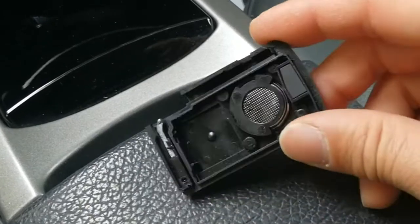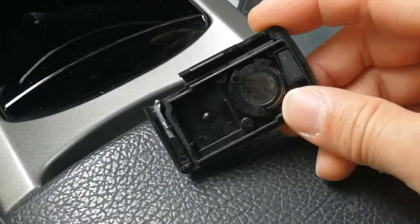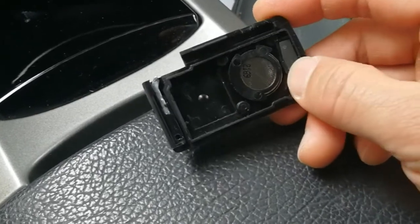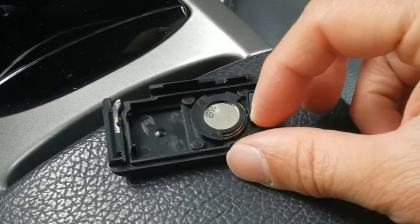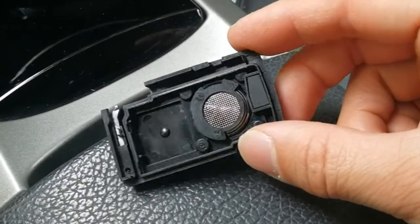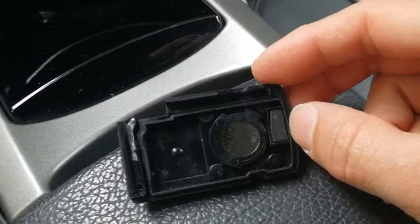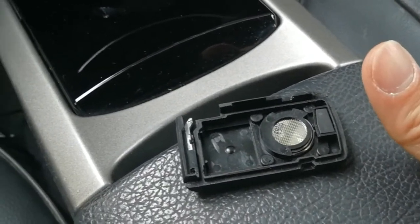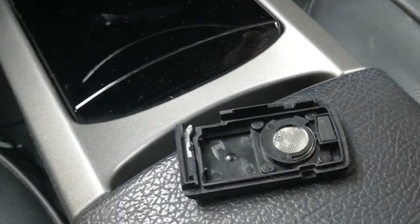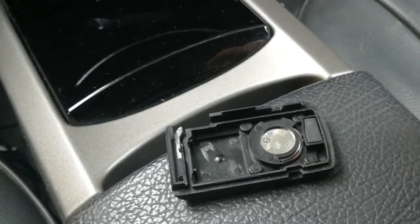If you need to move your existing circuit from the old remote into a new remote housing, make sure you also move this key chip — this is very important for it to continue to work. That's the basic construction of the Toyota Prius second generation remote control.